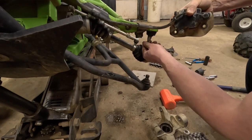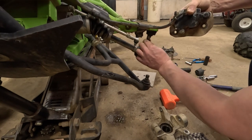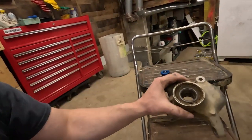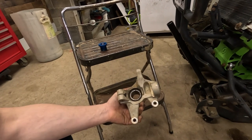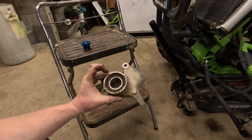I'm just going to check this upper ball joint. It feels pretty tight. The boot's ripped, but I think it's okay. So I got that front knuckle off. The upper ball joint is okay. I'm going to go ahead and show you guys - I'm going to grease this, clean this up, and grease this bearing. The bearing's okay, it's pretty solid, so let's get it done.